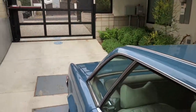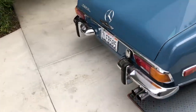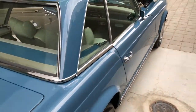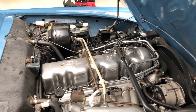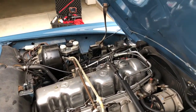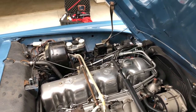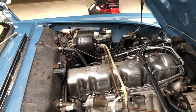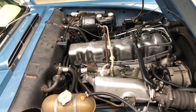I just looked back to make sure there were no major puffs of smoke coming out — still looking pretty clear. I'm going to let it idle for about 15 to 20 minutes to get it nicely warmed up and heat-soak the suspension, so that way when we move on to the road test, if there's anything loose, hopefully it'll come out during that process.